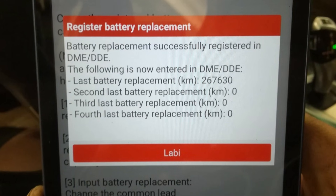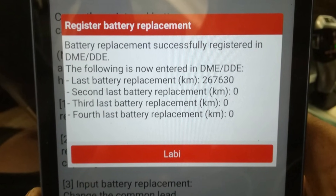If you replace and install a new battery in a BMW, it's highly recommended to register the new battery. If it's a battery of the same size, just register it with any scanner at a repair shop — it's a very easy and cheap task. If you install a larger battery, you will need to code it, which requires a BMW-compatible scanner and costs a little more. Until you register the battery, you may keep seeing this error message or other random messages, because the car's computer doesn't fully understand what's going on with the different voltage.